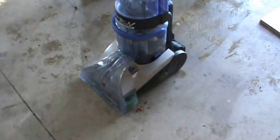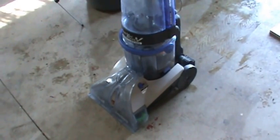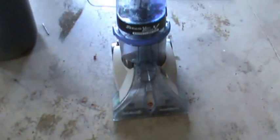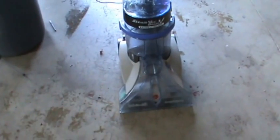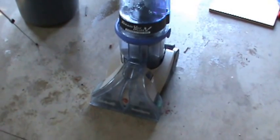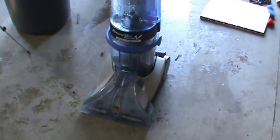It seems to be working as it should. This is the type of thing where you use your steam vac, it works fine, you put it away, and a month later you pull it out and it doesn't work. The reason is the moisture and water in there rusts up those bearings, and then that gearbox won't work — so you can just loosen it up a little bit and you should be good to go. I'm DoubleWide6, hopefully you enjoyed this video. You can check out my channel — I've got a bunch of other repair videos. Thanks for watching, any comments I'd appreciate. Take care.